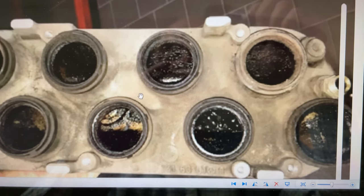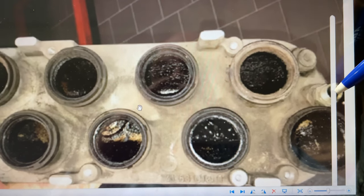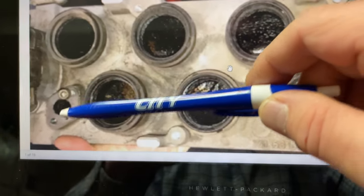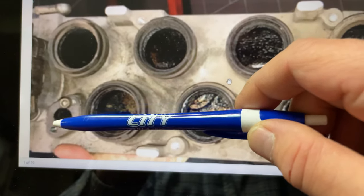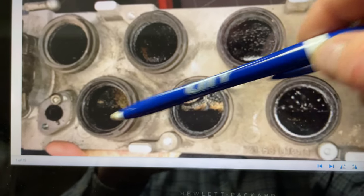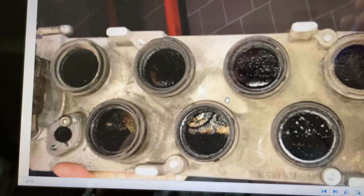As these cars get older, you'll probably be exempt from emissions testing anyway. What I'm probably going to do is install the European-spec metal seal plate to block off the EGR port — the German cars have a metal plate with a gasket secured with shorter hex key screws — and then disassemble the entire EGR system and clean it.